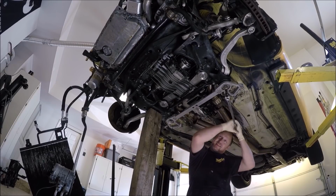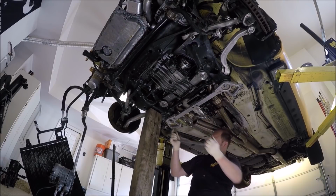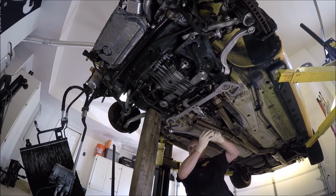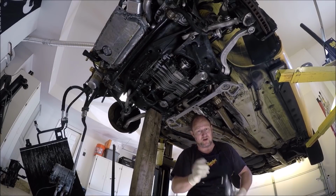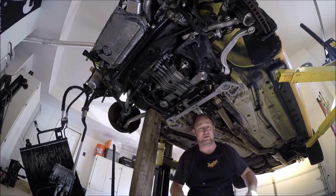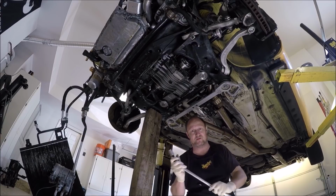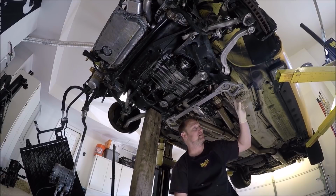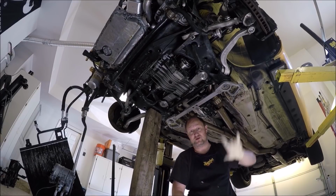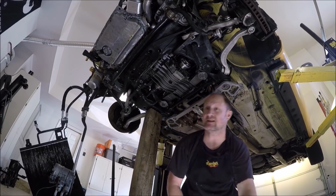Since I'm going to go all the way over here, if I can do it. Oh, there's no way. These bolts are pretty old. So you guys could do the quarter turn, put a pole on this. I'll probably end up doing it. Put a pole on this and just go the 90 degrees. These 13mm right here are 23 Newton meters. Don't over tighten. You could strip the threads.